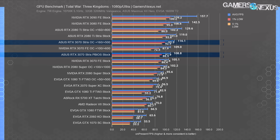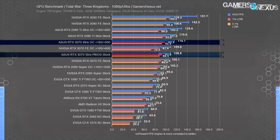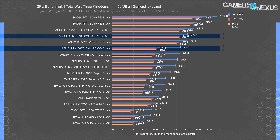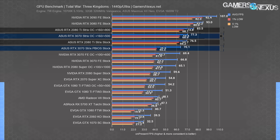We'll show some quick gaming benchmarks. For the full RTX 3070 performance, check our review on the 3070 FE — gaming isn't really worth running the full suite against board partners when they're this close. In Total War Three Kingdoms at 1080p Ultra, where even the 3080 is binding on CPU performance, the 3070 Strix on its stock P-BIOS did 109 FPS average, improving by 6.7% to 116 FPS with an overclock — a huge uplift for this generation. Stock P-BIOS performance equals the RTX 3070 FE's overclock performance, and Strix OC performance is nearly 2080 Ti performance. At 1440p in the same test, the Strix 3070 stock P-BIOS did 70 FPS average, just past the 3070 FE's overclock. Overclocking the Strix got it up to 77 FPS average, past the 2080 Ti and behind the 2080 Ti OC. The 3080 FE only leads by 20% compared to the Strix OC performance.